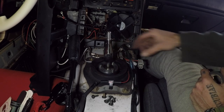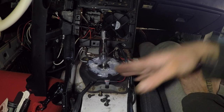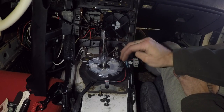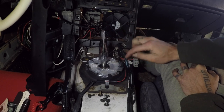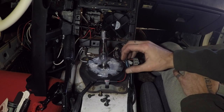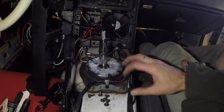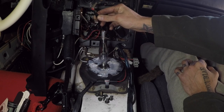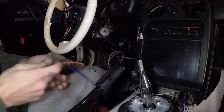I'm going to tape this area off with some metallized tape and then fill it with silicone so it doesn't leak exhaust gas anymore. I used aluminumized tape to make a cradle, looping it across so it has some flex, just to keep the silicone from dripping through onto the transmission. Then I used 100% silicone caulk, filling the gap and smoothing it from one edge — not touching the shifter ball — over to the rubber edge, so the transmission can still move and flex the silicone without breaking it. This will prevent exhaust gases from getting into the cabin.